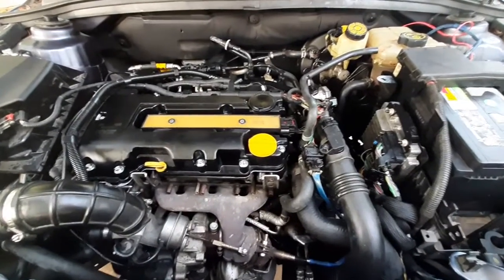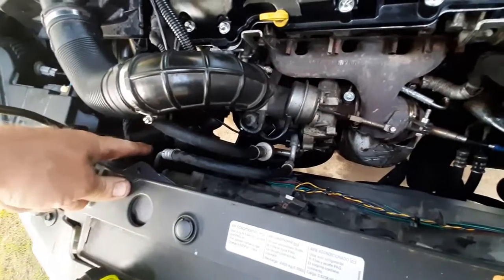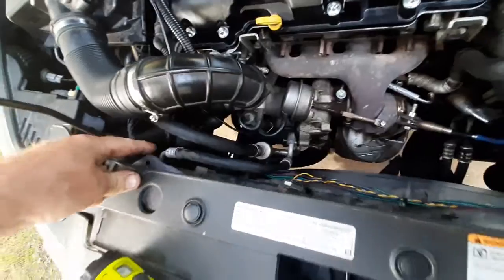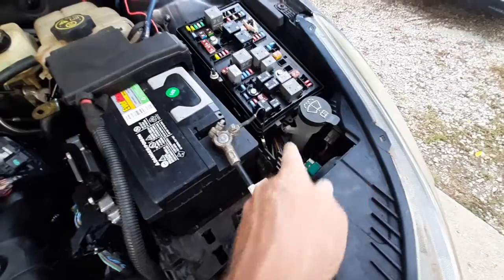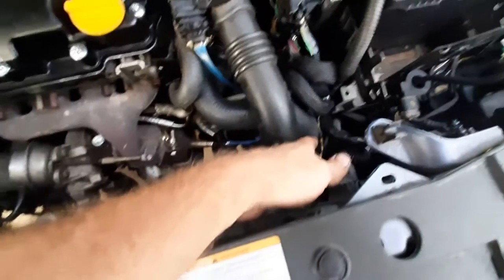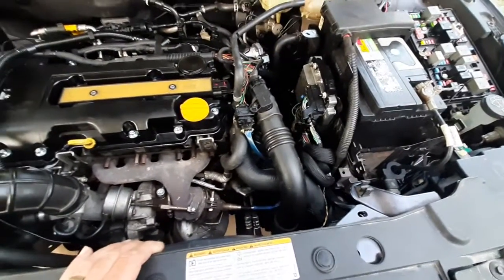If you've got your scanner, you can hook that up and see what each sensor is reading to tell if they're out. I had a trouble code — you can also look up trouble codes on the scanner. It was showing that the radiator sensor had a problem with the circuit. It was still showing pretty much the right temp, but had a problem with the circuit. That wire runs all the way down underneath the battery, runs straight through there, there's a connector harness, then it runs up through the bottom of the fuse box, and then it comes around over here for no particular reason. So I ran a bypass on it and ran the wire straight to the computer, just like the engine one is — it literally goes from the engine over to the computer. I did the same with these wires and that got rid of the trouble code, but the fan was still on all the time.